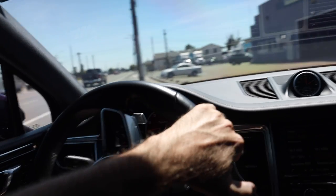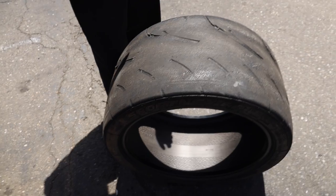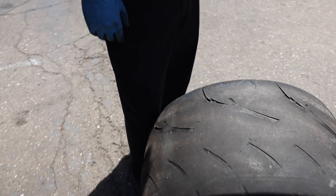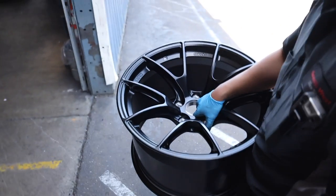I'm basically trying to get the proper fitment on this stuff and we'll see what happens. I just have a used AR1 to test with. 305 fits no problem; 315 people do it but they need a little more camber and possibly custom control arms. I'm going to see what happens. Sheesh, look at this bad boy — look at that, freaking beautiful.